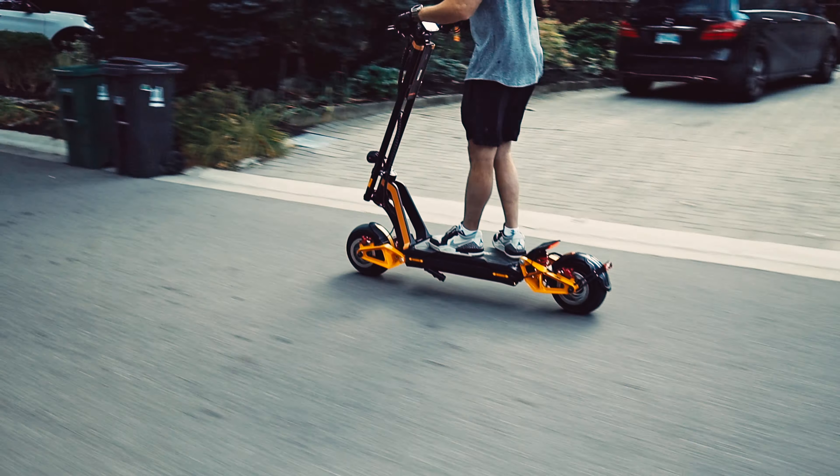I just wanted to mention one thing that's been annoying me a little bit. When I stop for not even a brief period of time, even at a light, the scooter will not go — it goes into auto park mode. But that can be changed through your settings in the app. Right now auto park time is set to 30 seconds, so if you're stopped at a light you're going to be stopped for more than 30 seconds. You can click to increase it — we're going to change the standby time to 120 seconds, which is two minutes, before it goes into auto park.